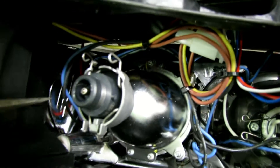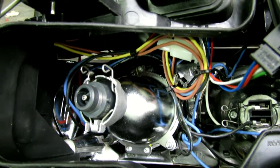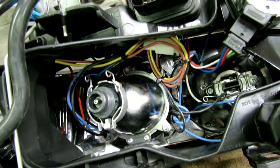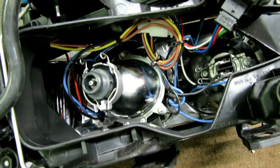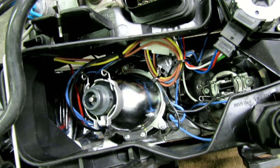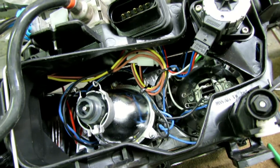There are a total of eight LEDs — four per headlamp, one set for high beams and one for low beams. If you replace them with LEDs, be sure to note the polarity, as LEDs will not light up if installed backwards. To confirm polarity, I powered up the headlamp on the bench and tested each LED to make sure they all lit correctly, because the LEDs themselves are not marked once they're in the socket.